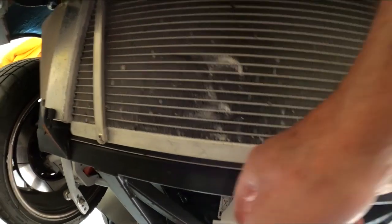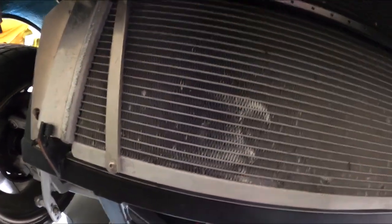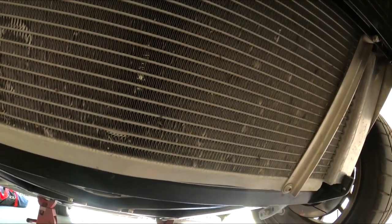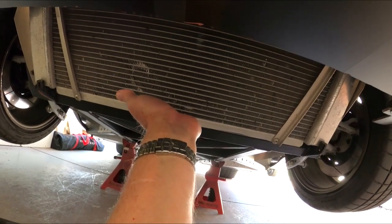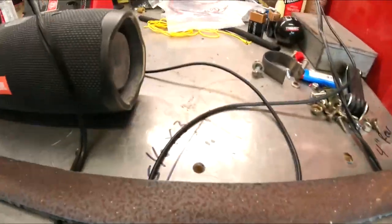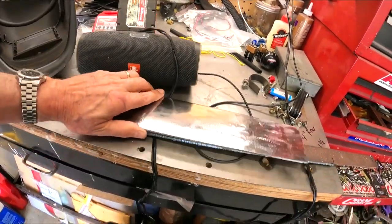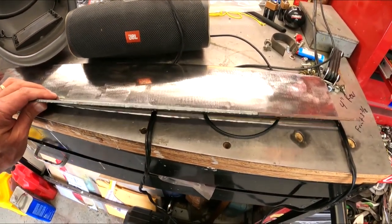You can see how it's going to weld up. I'll weld here, stitch weld across a few spots so I don't put too much heat in, then weld again on the other side. The other piece will angle up and I'll put a couple of gussets on the back side to keep it from crushing in. The piece fits pretty good in there. It's not going to lower the car at all — it'll be perfectly flush with the tube, maybe up just a 16th or 32nd of an inch, just enough to get a nice bead.